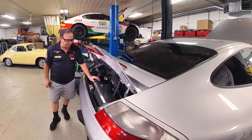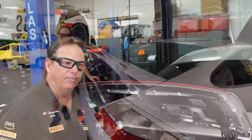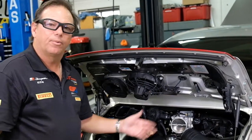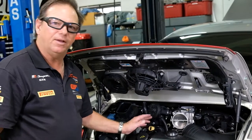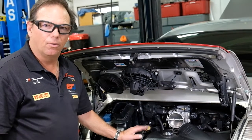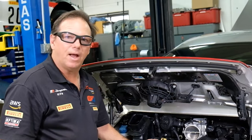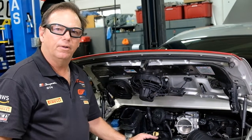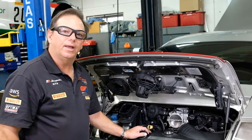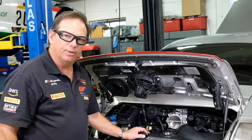Let's cover the cooling system for a moment. There's one test in particular where you can check the cooling system — your coolant, your antifreeze. Most people don't understand that the best liquid medium for cooling is water, but we can't use that alone. We want lubrication qualities for the coolant pump and antifreeze protection. So we run it at a 50-50 mixture with Porsche coolant or Driven. I would go with Porsche coolant and distilled water. Don't use tap water because there are minerals in it that can help electricity flow through your cooling system, which we don't want.